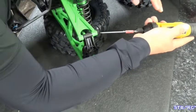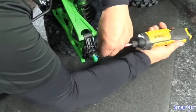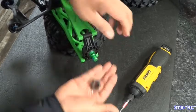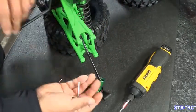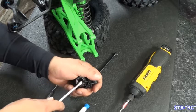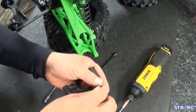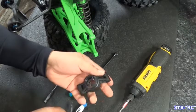Let's pull these little retainer screws out for the pins. Pull off our little clip holding our wheel hex, then push our pins out. Let's go ahead and change this out — all we need is our front bearing. Save the rest. Get your new knuckle and your new backside bearing, put it in place, make sure it goes in flush. Then put your front bearing in.